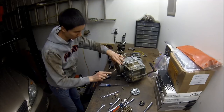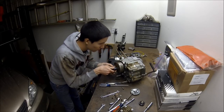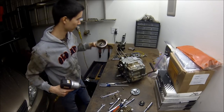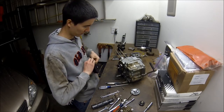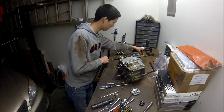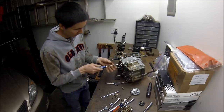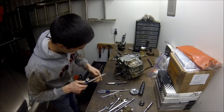The threads are really gummed up. Without that special puller it's very difficult to get the flywheel off — sometimes you can get away with using big pry bars. Same thing here with these screws, which are finger tight. Usually you need an impactor to get them off, but in this case it's not necessary.